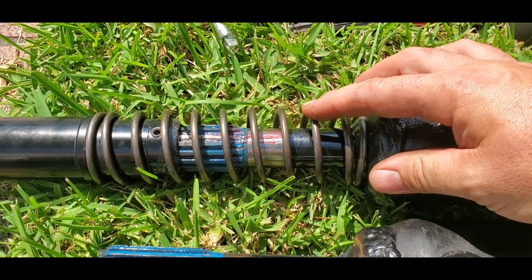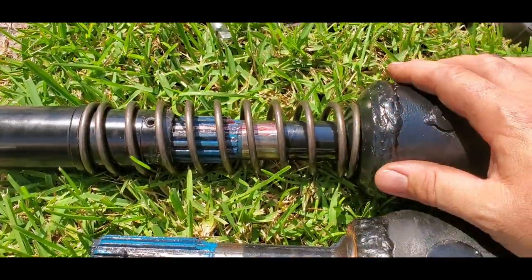Well, they don't. As you can see where that paint mark is, that's where the guy at the driveshaft shop had to collapse this in order to get it to balance out right. So the way I measured it, I left slip in the front and slip in the rear, but with that spring it held everything in so nothing would come out of the front of the driveshaft — not to mention my driveshaft wouldn't be butted up against my seal, destroying my seal like it did in the Blue Rose.